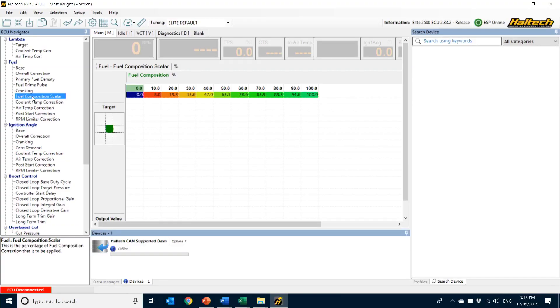There are a few reasons for this, but the biggest factor is the cooling effect that ethanol has on the incoming intake air. This is actually one of the big advantages of using ethanol as a race fuel — it cools the intake charge and helps prevent detonation, which means we can run more boost or higher compression. Nonetheless, this non-linearity between theory and real world application means the ECU needs a way to correct for that difference. So when flex fuel is selected as a fuel type, you'll notice there's an additional fuel scaler table in the fuel maps. This fuel scaler table allows the tuner to correct the actual amount of additional fuel delivered versus the theoretical amount required for that specific ethanol content percentage. The base map numbers that Haltech have in this map are the result of real-world testing on a number of high-performance turbo engines, and for most forced induction applications they can be relied upon.